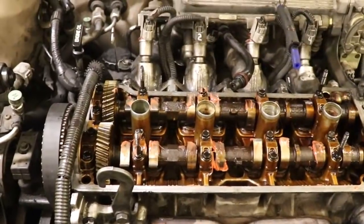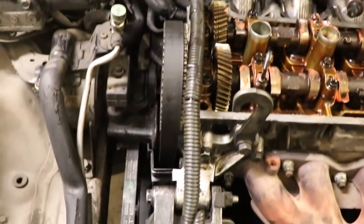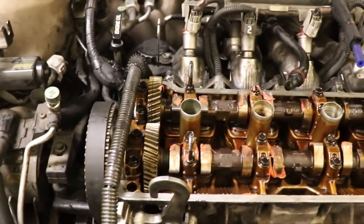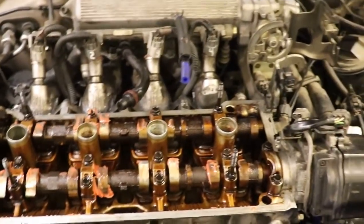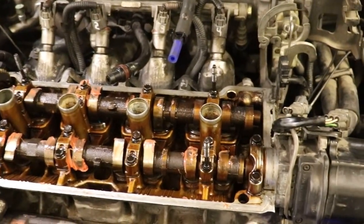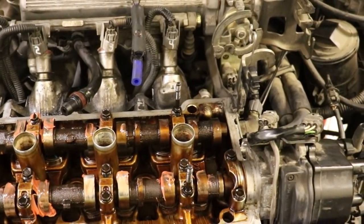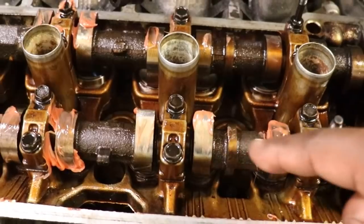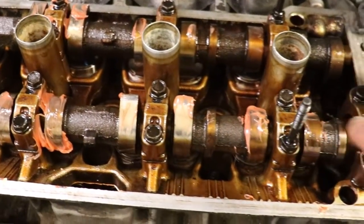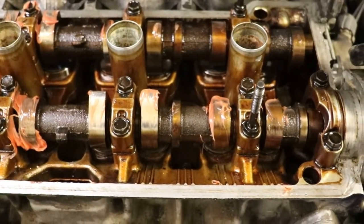All right, we got our initial startup grease on, timing belt on, all of the other serpentine belts are on, and this is going to be our final timing double check. Make sure that timing is right. You check the timing marks on the cams, on the front plate, and we looked at the sprocket hole. So if the timing is correct, this is the exhaust cam. The rotor on the exhaust cam should be pointing to the number one